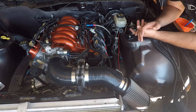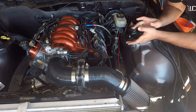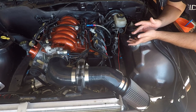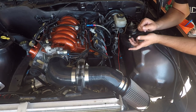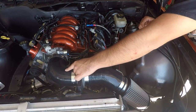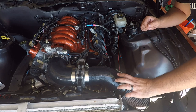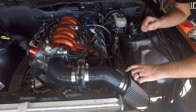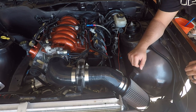This is my intake. I put it together using pieces from siliconintakes.com — it's a pretty cheap site and they have a huge variety of parts. I live here in Las Vegas, so my goal when creating the intake was to use as little aluminum as possible, because summer temperatures do reach about 117 degrees. My intake is composed of four parts: a 90-degree coupler off the throttle body, a 45-degree coupler, and a small three-inch piece of aluminum just to join the end of the coupler and the filter together — that's the only aluminum.